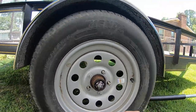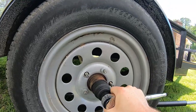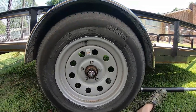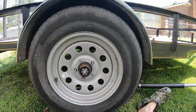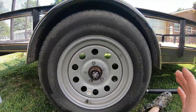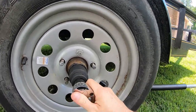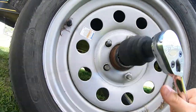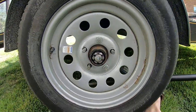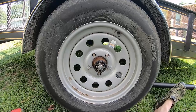I can still free-spin the wheel. We can go a little bit tighter because the hole is here under this - I've got to get this back around enough to get that cotter key in it. The wheel is still spinning pretty good. What you want is to be able to hand-spin it and have it continue to spin. If you can't spin it and it slows down really quickly, you've got it too tight. I think we can go just a tad bit more because I need that hole to line up just right. Now I can get that cotter key back in there. Spin the tire and it still continues to spin - that's loose enough.